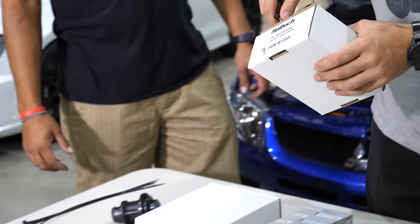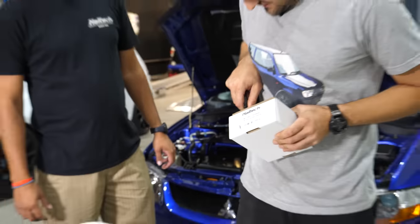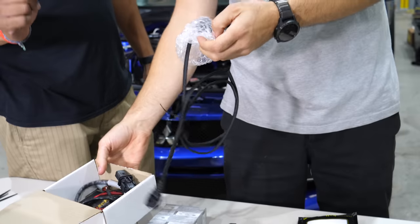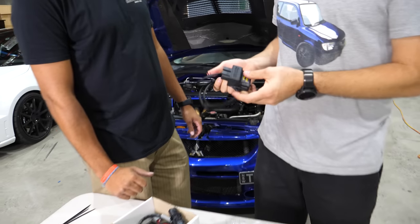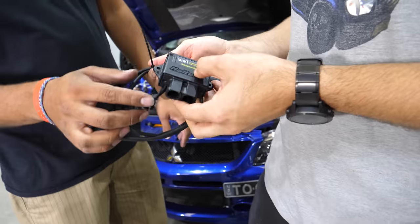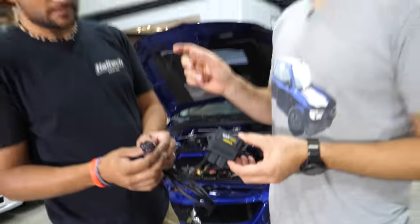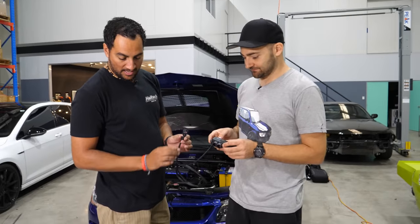Oh, wideband. This is a brand new one. What's special about it? This is the newer design, so we've gone away from the Platinum style silver box. Oh, it's tiny. Yeah, this one's pretty cool. We can mount this one out loud and proud in the engine bay, put it up on show next to your flex sensor or something like that. The sensor will plug directly into the 4.9 sensor now instead of 4.2. That's a newer version, with a smaller wafer, and it heats up quicker. It's a different design of sensor.